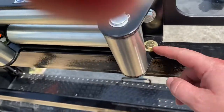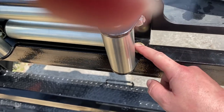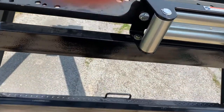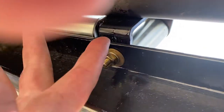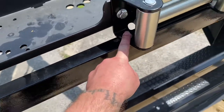I marked both sides because you can't drill with the bracket mounted on. So I had to take this off, mark my holes where I wanted to drill, then take this off, drill the holes in the trailer on both sides, put it back on, tighten everything down to its final position. Then, once it was tightened down, go from underneath — I marked each hole, which gave me where I needed to drill on the actual rollers. Then do the same thing: drill the holes for your rollers on both sides, starting smallest and working your way up.